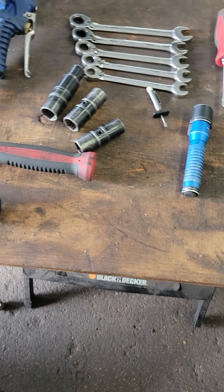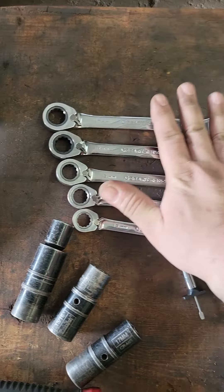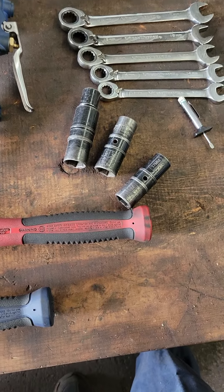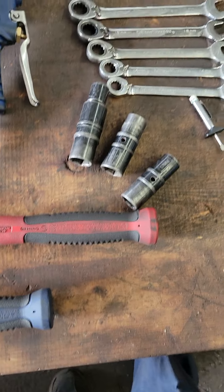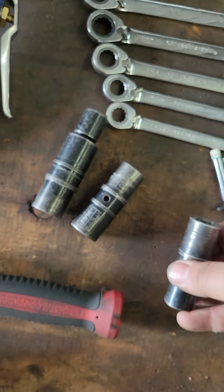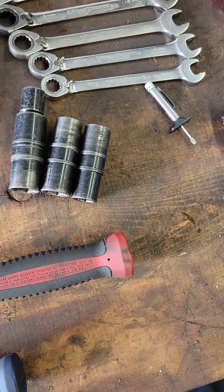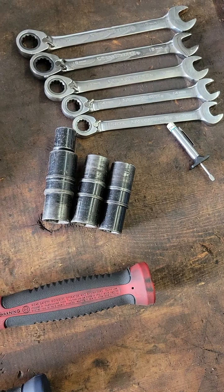The basic — they call it a master tool kit by Quinn. It's like 500 pieces. You're going to have standard and metric wrenches, a set of screwdrivers, and sockets and ratchets from quarter-inch drive to three-eighths drive to half-inch drive. Whenever you buy a socket, make sure it's six-point. Twelve-point sockets are just going to round off fasteners, and you're going to piss a lot of people off with those.